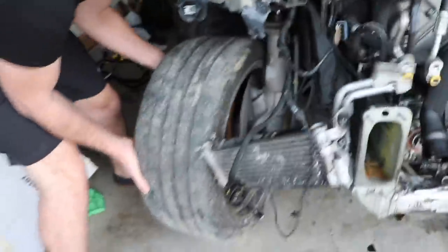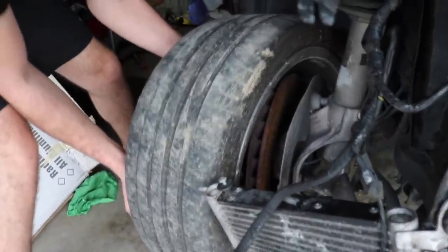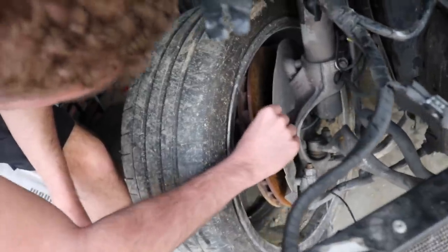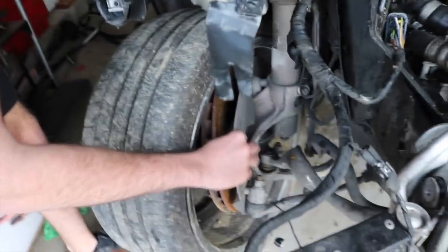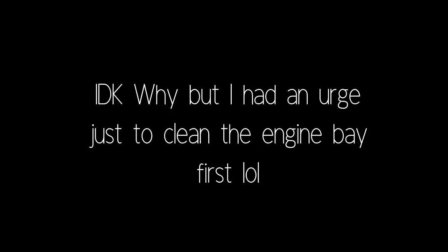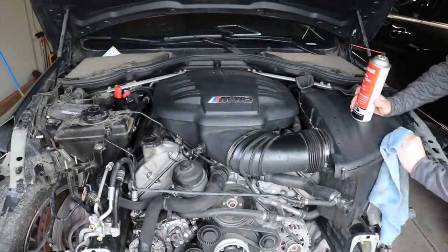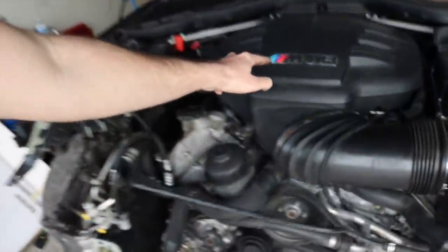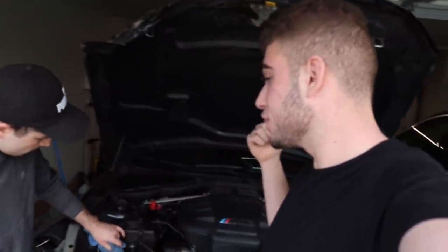Oh, it's like pushing back — it's on the rotor. The best thing is to go ahead and remove these bolts so we can move this whole assembly forward, because I don't want to mess up this plate or the caliper either. Shout out to my boy Johnny over here for detailing the engine bay with some brake cleaner. We're just going to go ahead and remove all those control arms and tie rods off that wheel, get the wheel off, check the caliper to see if it's seized, and see what we can salvage from this side.